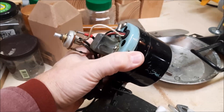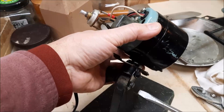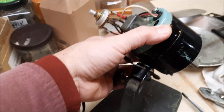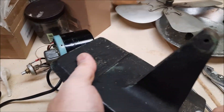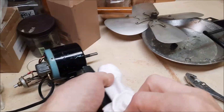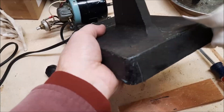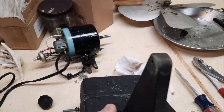We're going to repaint this in the original color. We got some paint at a local box store and we're going to take this apart so that each component can be painted separately. Prior to painting, we're going to wipe them all down to get any dirt off, and we're going to lightly sand them with 220 or 320 grit sandpaper just to lighten things up. So here we go.